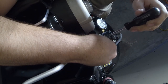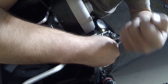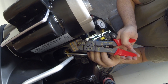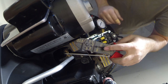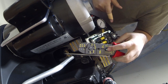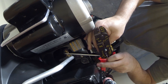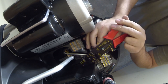Black wire tightened down. Now the white wire. Now all that's left is the grounding wire — it's 10 gauge. When you're stripping the wires, sometimes if I just pull, the insulation is still not cut 360 degrees — it's cut most of the way. So what you can do is loosen it up a little bit, rotate, then squeeze again, then loosen up a little bit and rotate around.